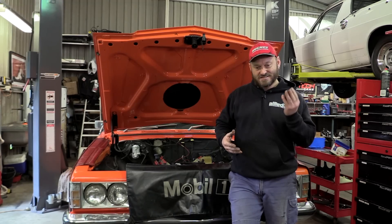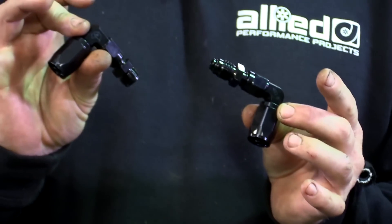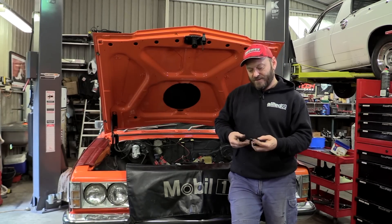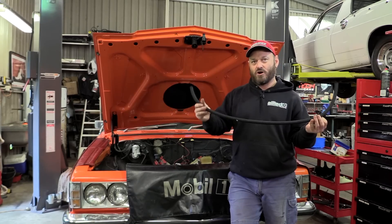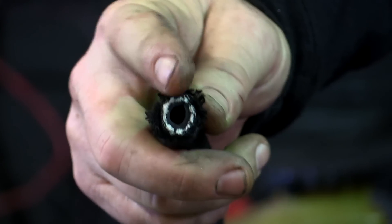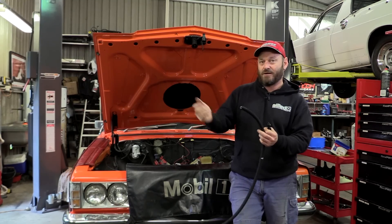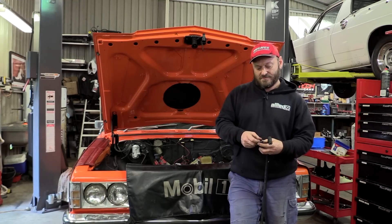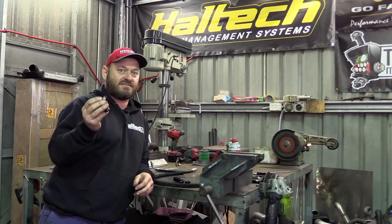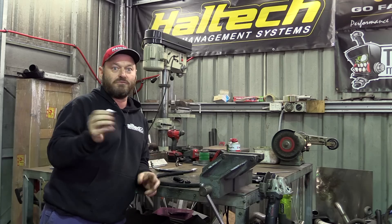The other way is a DIY method using the same technique as a hose manufacturer, but with much nicer-looking aluminium anodized fittings. These particular ones are Speedflow, which is Australian. It uses a hose called the 490 series - it is a power steering specific hose. It's basically a hydraulic hose but with a nice sheath over the top that keeps it looking good and stops it from rubbing holes in things - kind of like a fabric braid. The base hose is a dash 6 size, which is fairly standard for automotive power steering, and it's pretty much right for anything we'll ever work on.